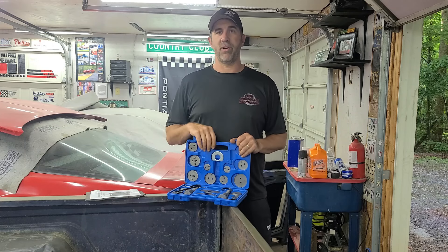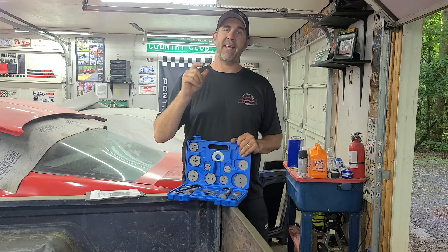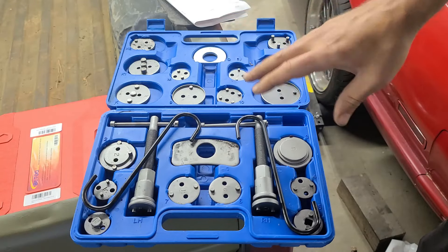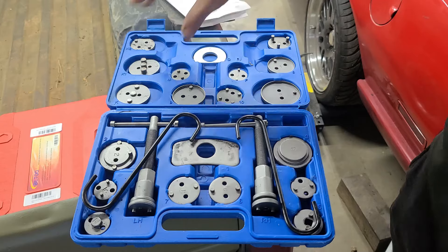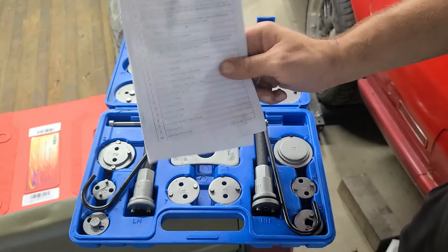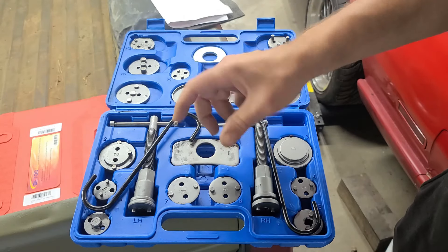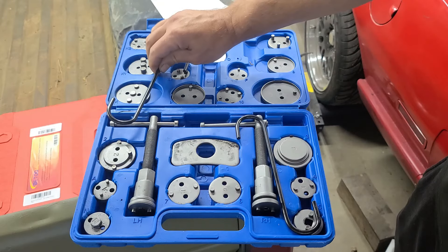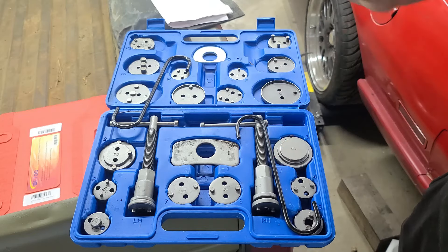You need to rotate it as you press it. That's when you need a kit like this right here that'll allow you to push that caliper piston back in while rotating it. This is the kit you're going to need in order to push that piston back in safely without damaging anything. It has different keys for all different makes and models, and it comes with a little list that shows you what should be the right ones for your car. If it's not on the list, you can always match up the key and make sure it works. It also comes with hangers that help hang the calipers up out of the way to keep that brake hose from getting damaged, like we always say when we do our brake videos.